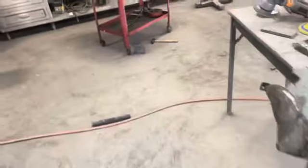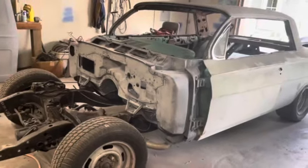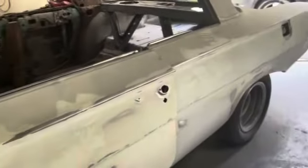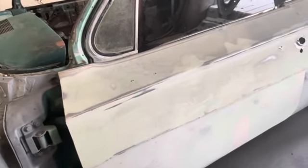So, anyway, when I wasn't destroying my daily driver, I was kind of thinking last night about where I want to go next with this. I know I talked about maybe painting the dash and painting the firewall. But I think what I want to do is, this side is ready to primer, except for this body line needs sanded along this door. Everything else is finished up. And I took a long block and was going over the top today. All this has is epoxy primer on it, and I think it looks pretty good. So I think I'm going to finish this body line. We're going to sand on that. And then I'm going to take that 2K primer and spray this whole side.